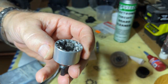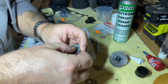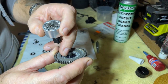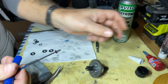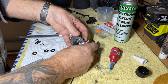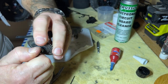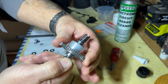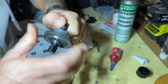After about five minutes you can see the oil is sitting there nicely, about three millimeters from the top. I throw the sun gear in, locking plate, spinning plate, locking plate — using the three-shimmed end — and pop that straight on there. I've gone back to the short bolts. Nice and tight, because these were a bit loose when I went to take them out today. Wipe off the excess and that diff is ready to go back in — that feels really tight and nice.